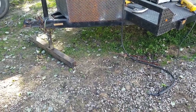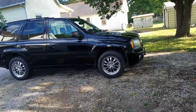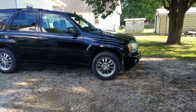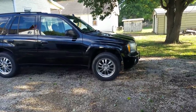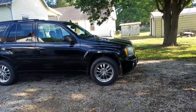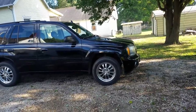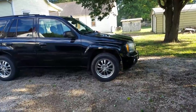What a Sunday. Started out working on mama's piece of junk — the thing was squalling real bad. We thought it was the power steering pump, so I put a power steering pump on it and it didn't fix it. Then I put a fan clutch in it because the fan wasn't wanting to work very good anyway and it was trying to overheat. That didn't fix it either. It ended up being the idler pulley — the bearing on it was bad.